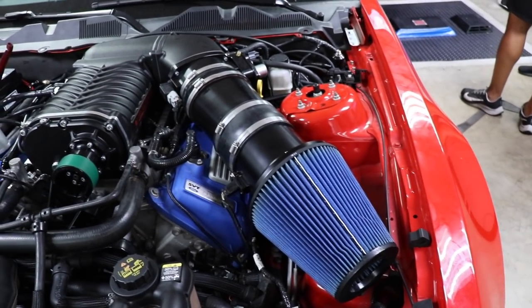Hello sunshine. Alright so we have the DD149 on. We're going to make a hit and see what happens. We're looking at the graph and really hoping that this is the reason why the boost is down. If it is, then maybe we just went past the limit of the JLT 148. The only change that we have made to the tune so far is for the throttle body and now we're making a change for the MAP sensor for the DD149. So let's hope we pick up some good power.